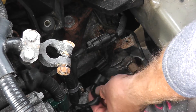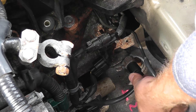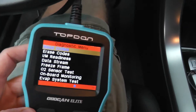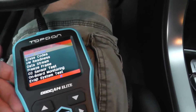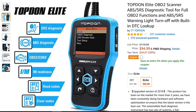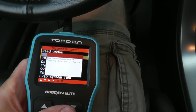If you do have a trouble code with your specific vehicle, the very last step is to erase any engine codes or trouble codes. If you don't have a scan tool, you can always go to a local auto parts store. If you're looking to purchase one — which is nice to have if you plan on doing your own auto repair — I'll include the one I purchased off Amazon. It can read trouble codes not only for the engine, but also the transmission, airbags, and ABS. It's a nice system and not too expensive. You would just go in here and erase any codes, and that's it.